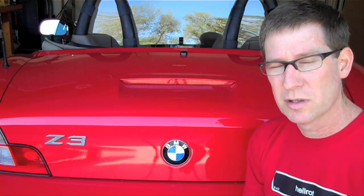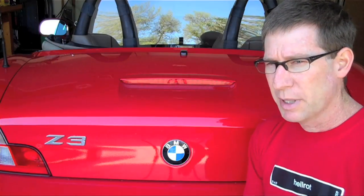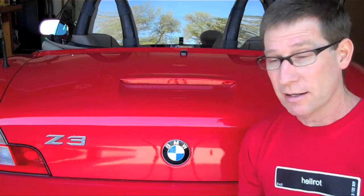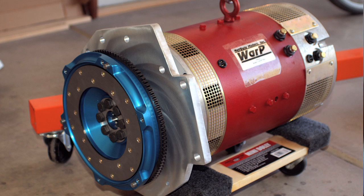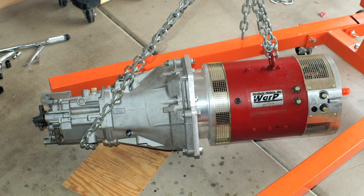The original model of the car was the 2.3, but after all of the changes that I made to it, it was no longer a 2.3, so I thought I should rechristen it. It's now the BMW Z3 EV. I don't know how many people actually noticed that, but it makes me happy. There are a couple of other things I wanted to show you on the car but I can't because they're obstructed. One of those is the motor itself — it's directly underneath the batteries here. I chose to use an 11-inch series-wound DC motor by NetGain, the Warp 11 motor.